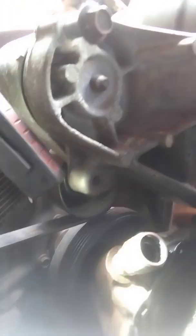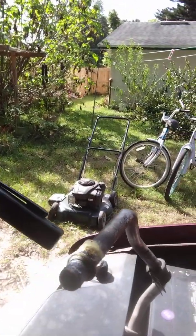And I'm going to change the coolant inlet right here. You can see, I hope you can see, where this connects down on there. I'm going to make sure I change those. I don't like those. I'd rather have something that tightens down directly and goes right to the heater core instead of having a quick connect. I'm a little worried those leak a little bit of the pressure when I'm trying to build up pressure in the engine and pressure test it and everything.